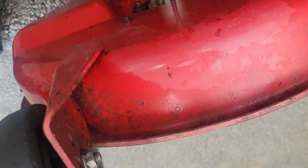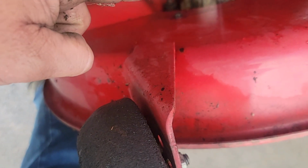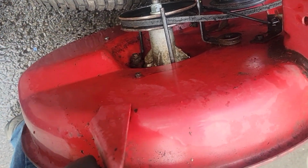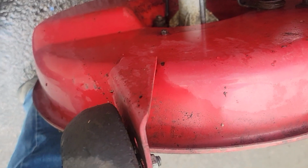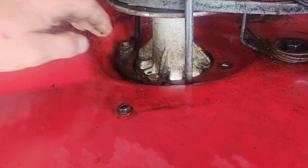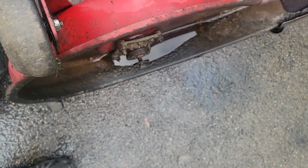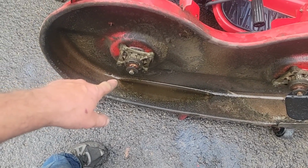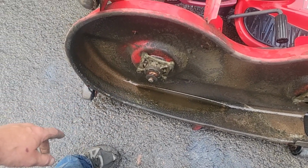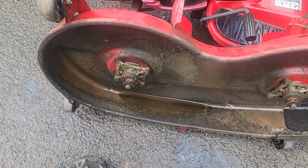I used a vacuum cleaner, and it's a 16-gallon over there. And I sucked all this junk off. I got a half a barrel. I took the shield off both sides of the belt, because you can't clean it when it's on the machine, because that guard is all the way around here. There's holes in the bottom, and it lets water back down under, I believe, but that lets a lot of debris up on the deck, and I think something ought to be changed there sometime. But yeah, we gotta get them bolts out, probably take that whole spindle off, and then drill them out and put a bolt in, like a 5/16 by 2 or whatever bolt.